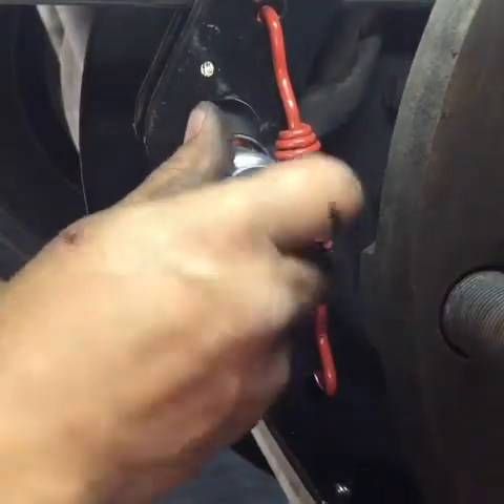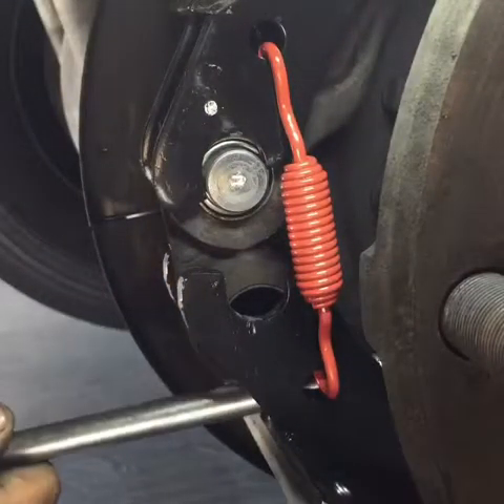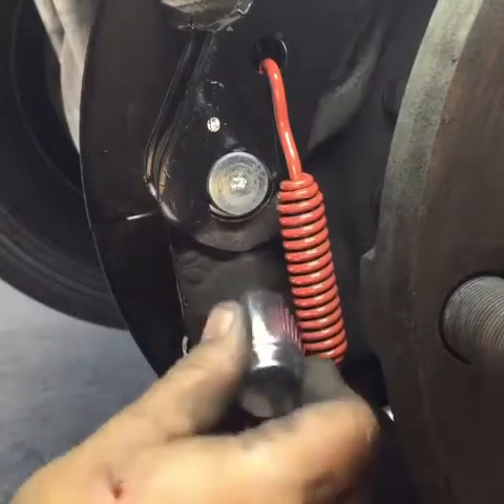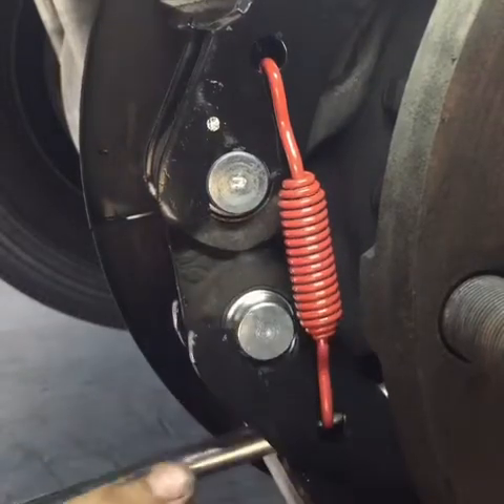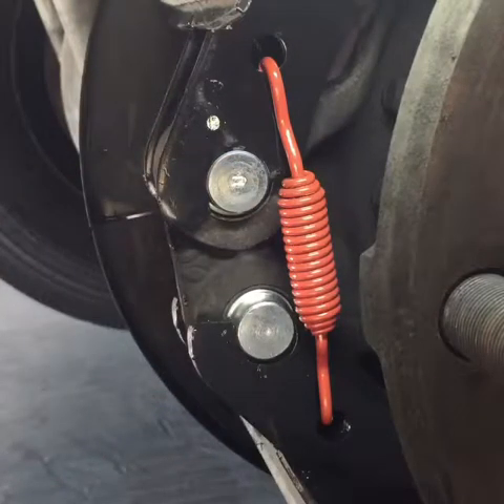Pull this up, insert my roller, and then there's one — then the bottom — I do the same thing: make sure the springs are in place, push down on it, insert the roller. And as you can see, it's not that bad. I mean a little bit of elbow grease — it does take a little force behind that half-inch extension, but it ain't that bad. I know they make special tools and stuff like that; we just kind of made our own. Let me go ahead and get this drum back on it and get to the other side.